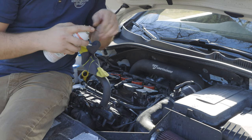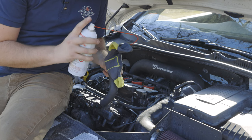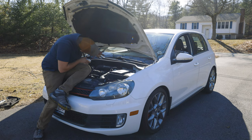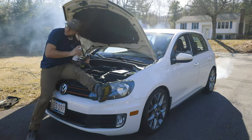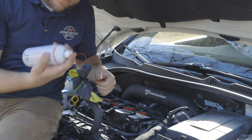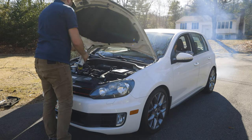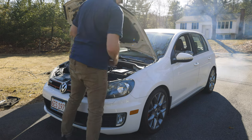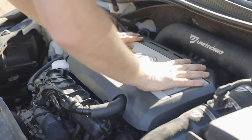Your partner is going to hold the throttle at roughly 2000 RPM, keeping it steady while you spray the Seafoam into the intake. The exhaust should get a bit smoky — that's okay, it just means the Seafoam is working through the system. After about seven or eight minutes, check how empty the can is. If you're good, have your partner shut the car off. Then hook back up the vacuum line and put the engine cover back on.